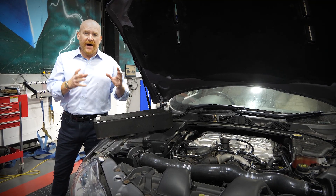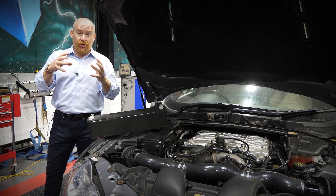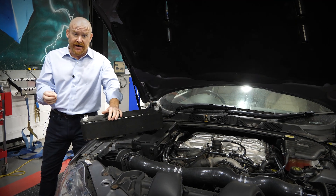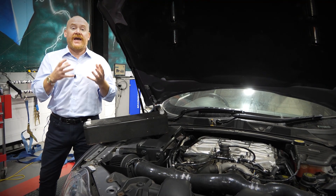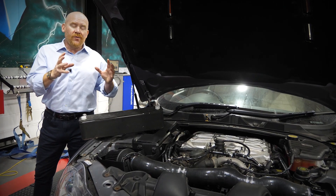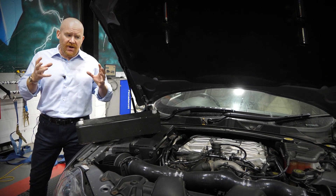This is even more serious. It's bad enough that the ECU is fighting you and trying to take some of your power away, but if you start to get detonation inside the engine it can do a lot of damage. Detonation is caused basically by too much pressure inside the cylinder in too hot conditions — the combustion inside your cylinder explodes without the use of the spark plug, so it's pre-ignition. Before the spark plug is fired, your air and fuel mixture can detonate and your power is produced too early for the piston. This can cause damage to your pistons. In the old-fashioned days you'd retard your distributor to stop that, and we can do that electronically too, but retarding your ignition again takes your power away.